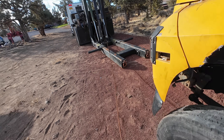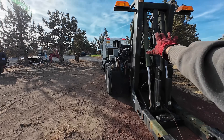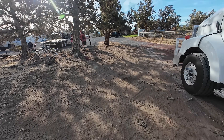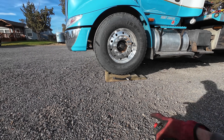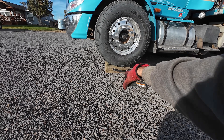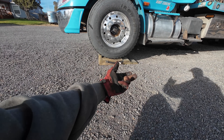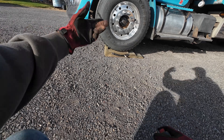Obviously with those legs being so thick, very low clearance trucks and low front bumper trucks are a problem. To get around that, you build yourself some little ramps. The guy I sold this to - up on the coast in Oregon - he built a set of ramps. They just step up and have a little stop at the end with handle straps on the side. If you have a low truck you're trying to get those legs under, you put the ramps in front of the tires, and then use the bottom winch to winch the vehicle up onto the ramps. Then you've got room to hook up to it.